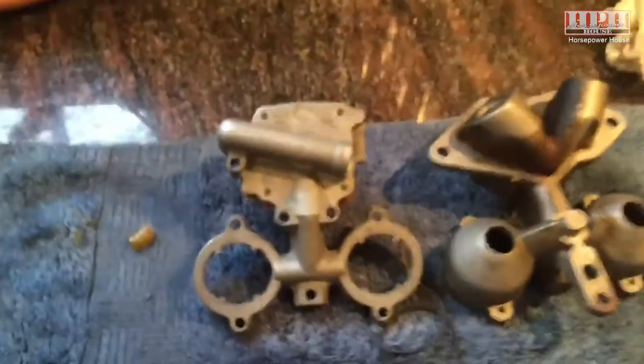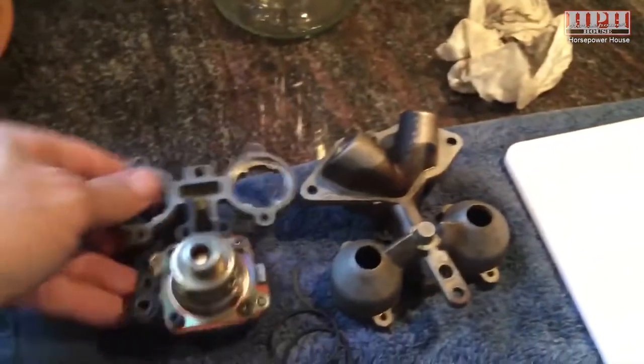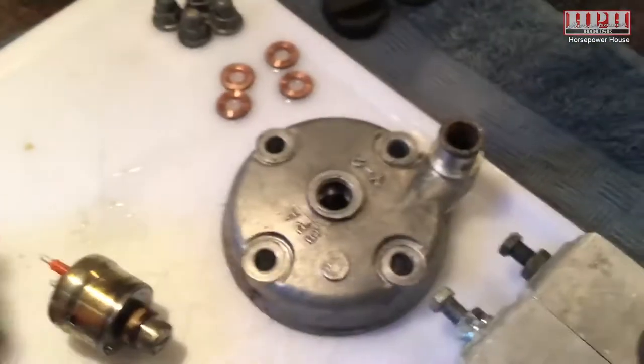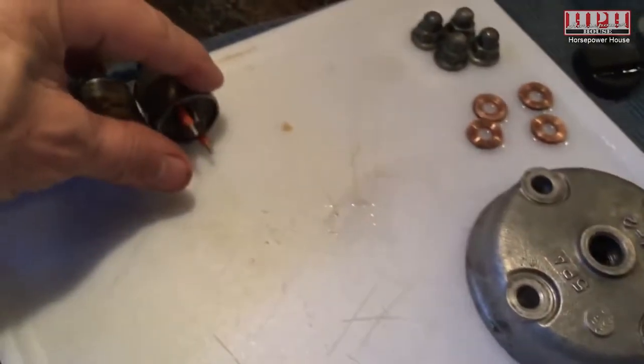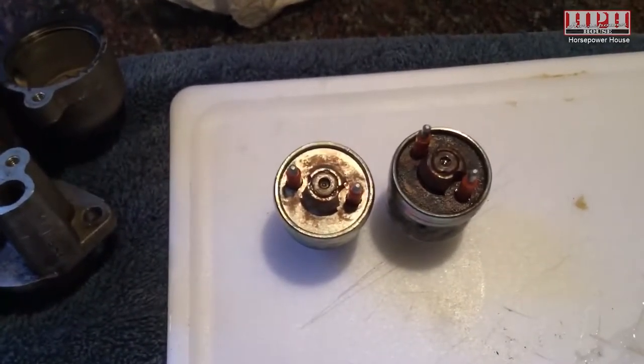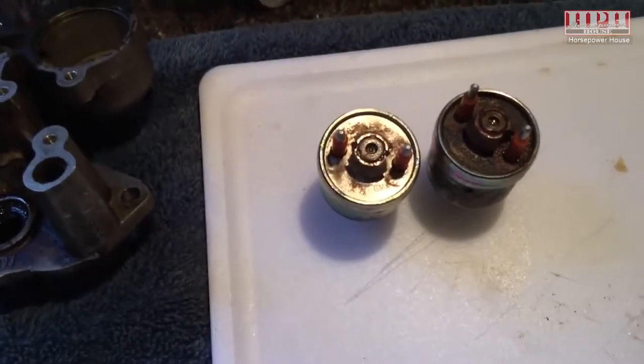The one on the left has been done already. This is a little fuel injector pod for a Chevy truck throttle body — looks pretty nice. Look underneath the brass piece, that was filthy before — it was horrific. These both looked basically the same before I started, they're the same metal from the same part. And here's an actual fuel injector from the same vehicle — underneath looks pretty nice. These were in for about 15–20 minutes at 160 degrees, no hand brushing whatsoever.